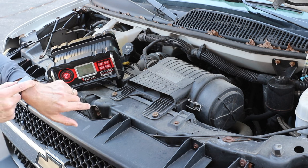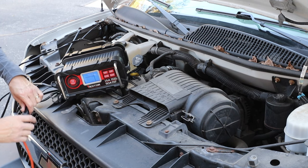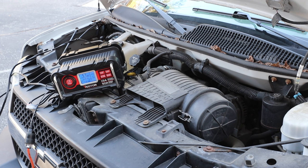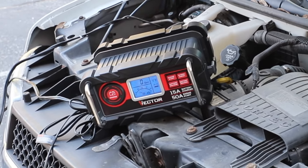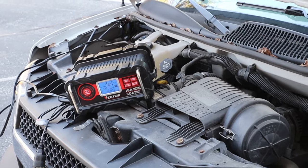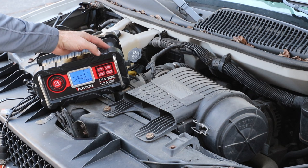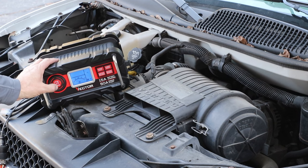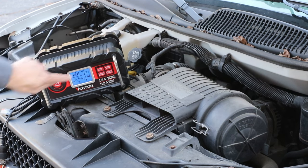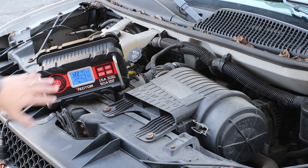Not quite there. We're going to try it again — disconnect it, wait five minutes. It sounded like it was almost going to start but it didn't. Okay, we waited five minutes, trying it again. Charging the battery, counting down from 60 seconds once more. Success! We're going to charge it further — it's reading 12.2 volts, and we want that up to over 14, so we'll let it keep going.